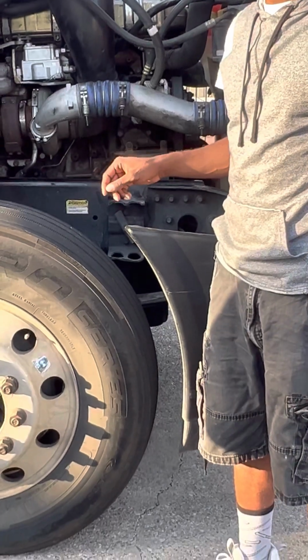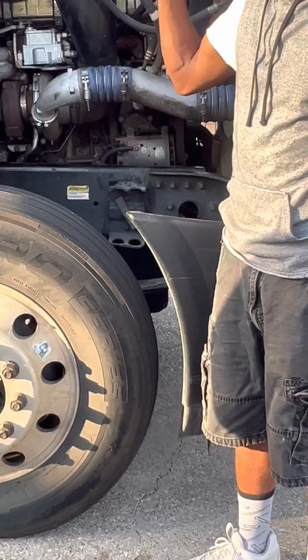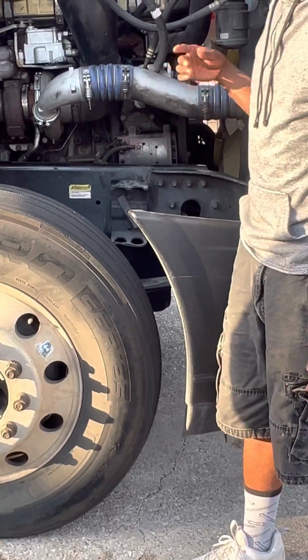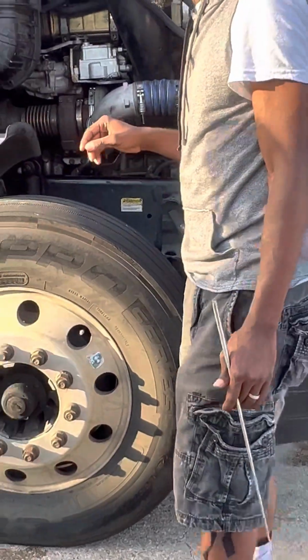I know it's about to be summertime. If you hear a car crank up, they cut that AC on, and it starts screaming, it's because they need a new belt. Usually when it's making that sound, their belt is frayed. That's why they need a new one.